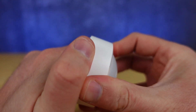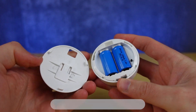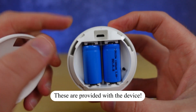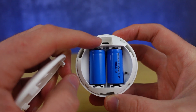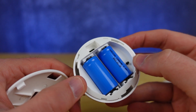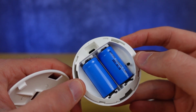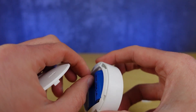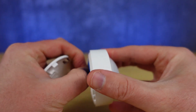Next, we need to power our sensor. The Q-Sensor can operate on two CR123A batteries and will last for about a year, or you can use the provided USB power cable and adapter. It's very important that you don't set up with USB power, then switch to batteries. If set up with USB, the sensor will keep its Z-Wave radio on at all times, which will drain your batteries faster than I eat a bag of chips. And I have a serious chip problem.